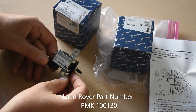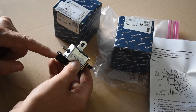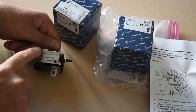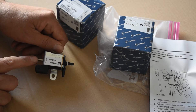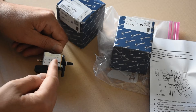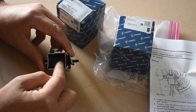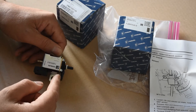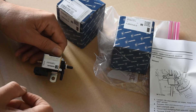If you look at the modulator here, you'll see we've got an electrical connector that links directly to the ECU, and then you've got one, two, three air pipes. The pipe on the left here takes an air feed directly from the turbo, and then inside there's a solenoid valve. You can see the barrel shape for the solenoid there, and that solenoid valve dictates where the air is fed during operation.